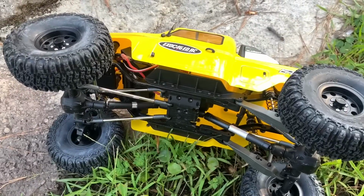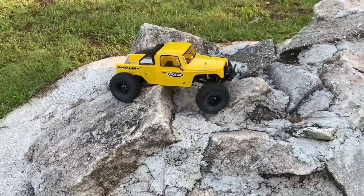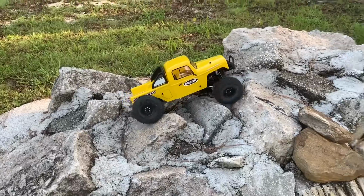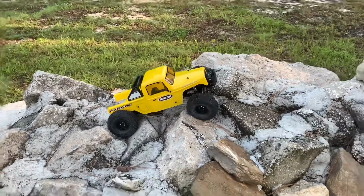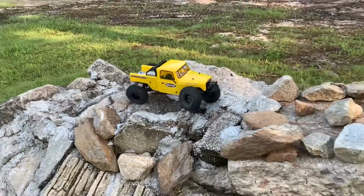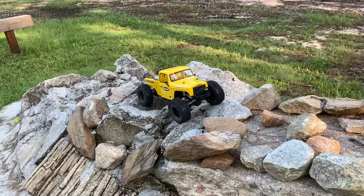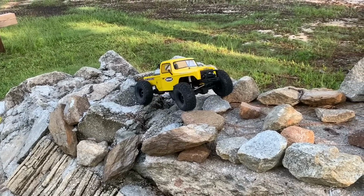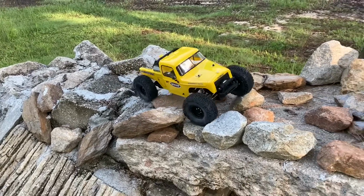I don't think so. Now the overdrive, it fits like, if you ever notice when you turn the tires shake a little bit, that's the phasing of the U-joints. And when you turn real sharp, you can actually see it. If you're turning, even driving slow, it'll kind of speed up and slow down, speed up, slow down. That's just the nature of the U-joint.